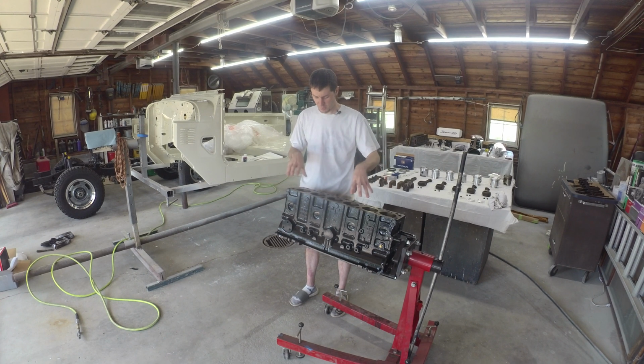So it's going to be a little bit of work once we get this in the chassis. Got to bend up some fuel lines to snake around. Got to fabricate a little bit to get that Sniper to fit. And we're going to fiddle around a little bit with the Holley distributor, trying to make that work with the 2F. They sell one for the GM 235 6-cylinder. I think it's a 235, but it's a little bit off, so I had to do a little bit of fab work to make that adjust to fit the 2F, which is a little unique.